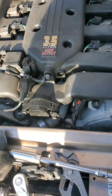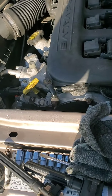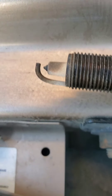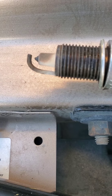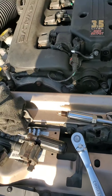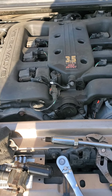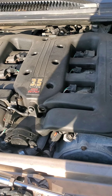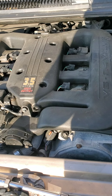That's all there is to it. Check each spark plug — they should have maybe kind of a tan color like that. I don't know how old these spark plugs are, but the car runs really good. It is overheating though. I replaced the thermostat and I think it's going to end up needing a head gasket repair, but I'm going to check all my other options. I know the fans are coming on, but maybe there's some kind of restriction or air bubble.